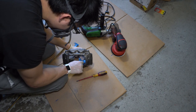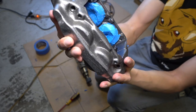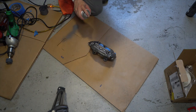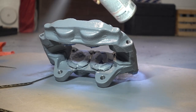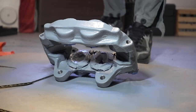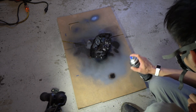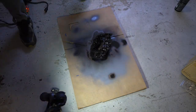Go ahead and place some masking tape over the caliper to cover it from getting dust and paint inside when you spray paint it. As you can see, it's nice and covered now and ready to go. Wipe it down with a fiber cloth, make sure everything is good. Start with the primer — go left and right, gently a couple of passes, then let it dry for about 15 minutes and redo it again. Then apply the base coat, going left to right and top to bottom, making sure you cover the entire caliper evenly. Let it dry and do a couple of coats.